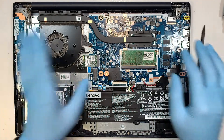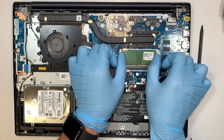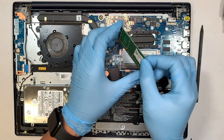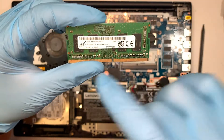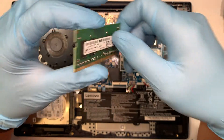Here is your DDR4 RAM. To upgrade the RAM, you can just push the two clips on the side, push both sides and you can slide the RAM out at a 45 degree angle and get yourself a replacement or upgrade. This one is running on 4GB RAM — you can actually upgrade to 8 or 16GB.